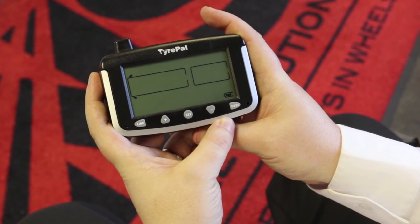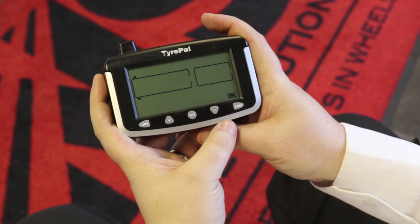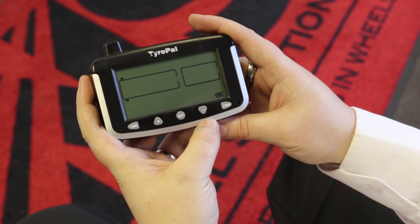In terms of your own tire pressure alert levels, our recommendation is that you set your tire alert levels 20% above and 15% below the cold inflation pressure. This gives you a window in which your tyre pressure monitor can work and will allow the tyres to warm up and gain pressure during use.